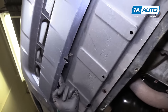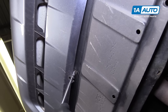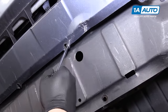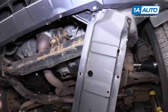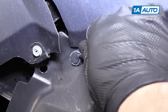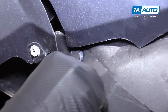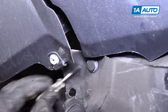The bumper has broken, but the bolt is there, so I'll remove that bolt. Same thing here — bumper's broken, but the bolt is still there holding on this front shield. Just the clip is holding the shield on now. I'll pop the clip out with a flat-bladed screwdriver to unlock it. Sometimes these break — this one looks kind of brittle and discolored, it might break. If it breaks, just replace it with a new one.